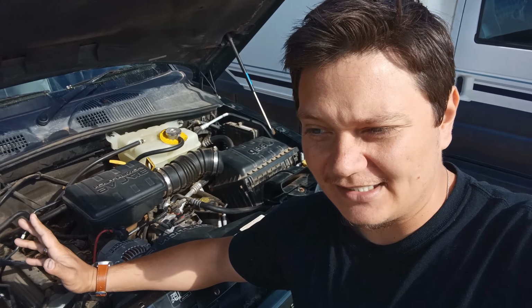So the very first thing that happened was I had like three check engine lights, and I was thinking, why is this happening? Why do I have three check engine lights? The check engine light usually comes on for an O2 sensor, and in my case, with my luck, I figured it was just an O2 sensor. Okay, bank one sensor one, P0031, upstream driver. So I replaced it, and still all the codes were present, nothing changed at all whatsoever.